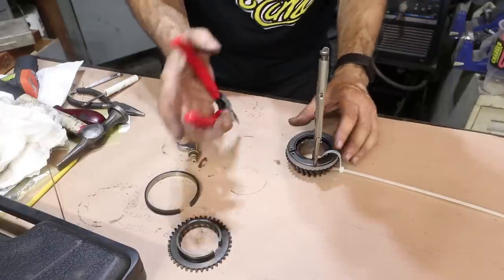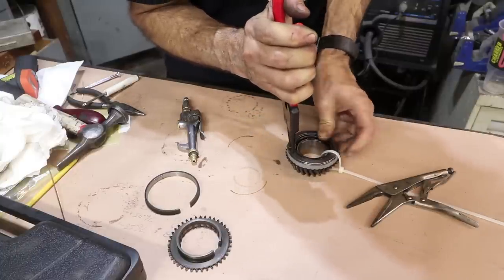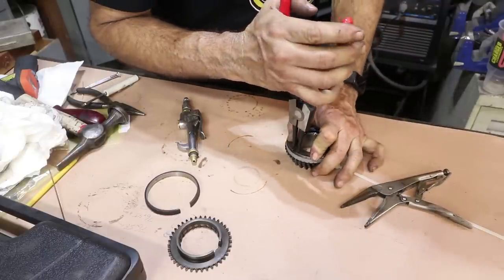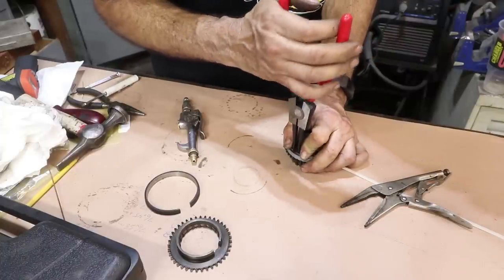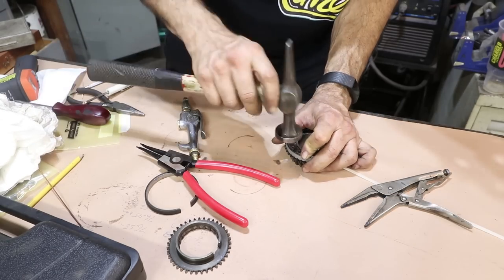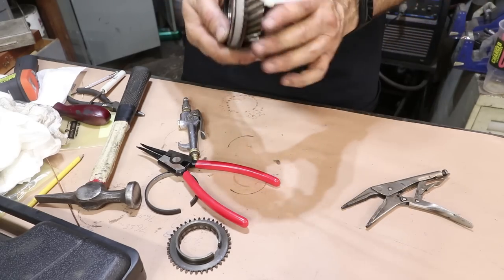Putting this right back the way it was — the Z's were pointing up. This one had the two wear marks on this side. It looks like the bands do have a direction: there's a little rib on top pointing up. I confirmed on third gear that this rib also points up. The new synchro goes on just like this, and I confirmed it fits inside the dog teeth exactly the same. There's a bevel on the synchro and on the teeth that seems perfectly matched with the new dog teeth and the new synchro ring. Using a zip tie so this doesn't fly loose. That's on — so that's fourth gear done.